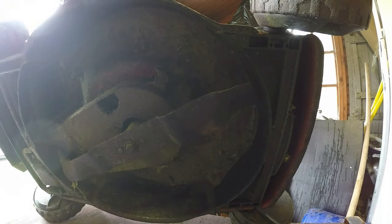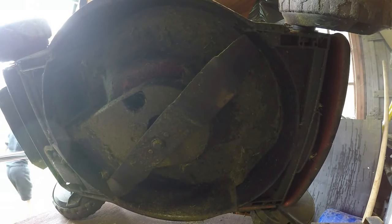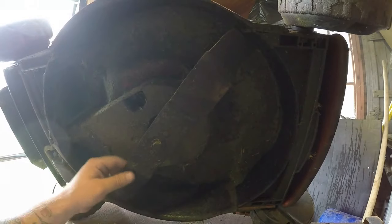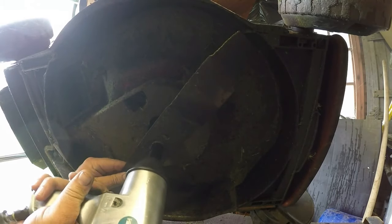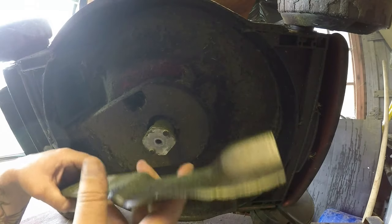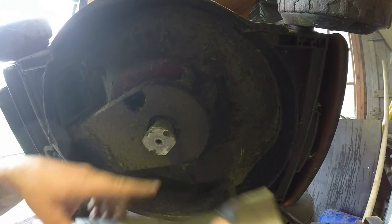Let's start with removing this blade. I've got my air compressor fired up. I'm going to fire my impact gun up, only because it makes short work of these old blade bolts. It's not wickedly bad — it just wants a new edge put on it. It's actually worse on that side, but I'll grind a new edge onto it anyway.